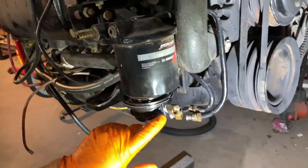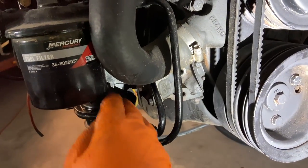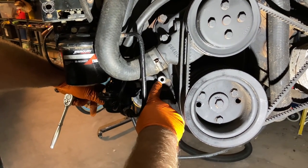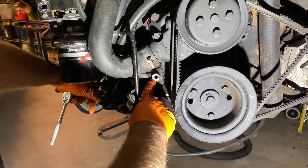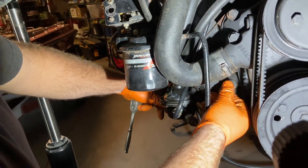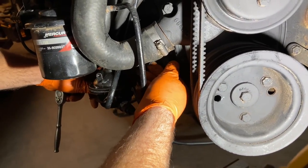I've got the bolts started. I'm going to use this access hole to push through there and hold the shaft in position so we have room to get our actuator for the fuel pump up in there. Got it started, got our gasket in position. Don't forget to reinstall the bolt that we removed to access the fuel pump rod. It's also a good idea to put some silicone around that because it could be a place where you get an oil leak, since it has direct access to the engine — there's quite a bit of oil that runs down and keeps everything oiled up.